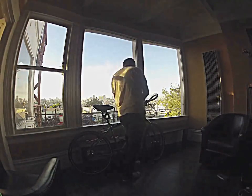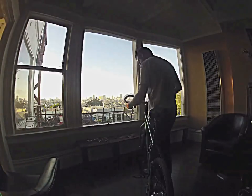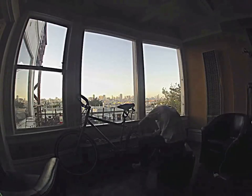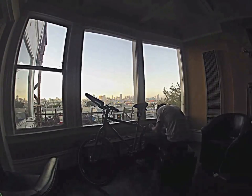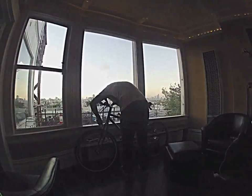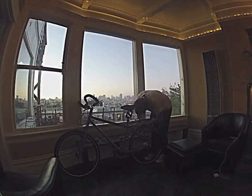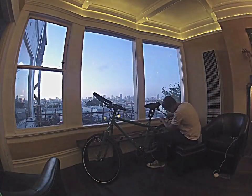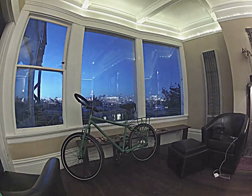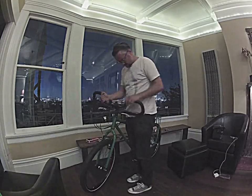This is the final part of the build. Now having got a bike that is completely rideable, I'm going to do the remaining bits and pieces — like putting the tape on the handlebars. I have cork tape and some gel padding underneath to ensure that it's a smooth ride on those butterfly handlebars. Those butterfly handlebars give you a lot of different places you can put your hands, so that as you ride over time throughout the day you can change your angle a little bit and it stops you getting too weary. Then it's putting everything together — putting the rack on the back, which is what the panniers and bags will attach to, and putting the attachment on the front of the handlebars, which allows that bar bag to go on too.